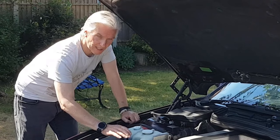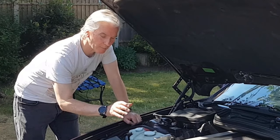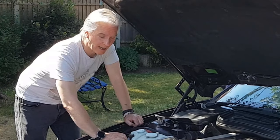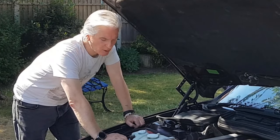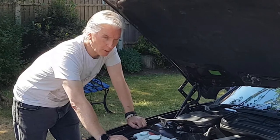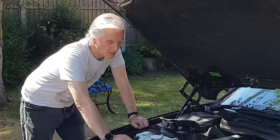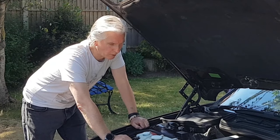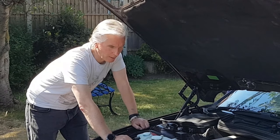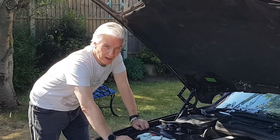You're actually setting the timing with the timing chain tensioner. It has to push very hard and keep that timing chain perfectly tensioned, or the timing of both banks will be out because you start getting slack in the chain. Anyway, that's our next plan. We'll take the time, I'll go through exactly how you change the timing chain tensioner. Difficult to say that word sometimes. And to do it properly so that we don't actually run the engine when we put it back in. It's very important we build up hydraulic pressure in it before we actually fire the engine up, because it's that point that you start thrashing the chain guides to bits. No tension on the guide, timing is off, and you thrash the plastic to bits.